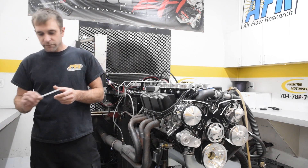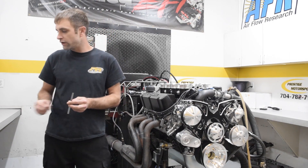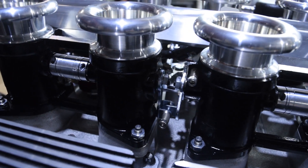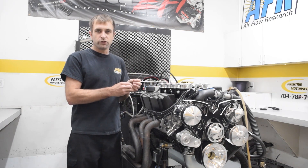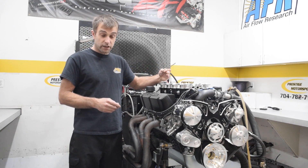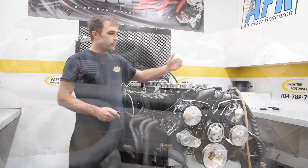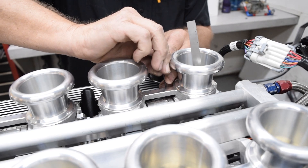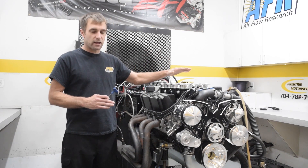We start with a simple feeler gauge — we've cut and trimmed quite a few of these and they serve two purposes. First, there's a screw on each side that controls all four throttle bodies. We take a 3-thousandths feeler gauge, put it between the throttle lever and the screw to get a base 'closed' setting, getting both sides close. Then with a simple allen key, we turn one complete turn on both sides. For a bigger engine like a 582 big-block Chevy, you may go one-and-a-quarter or one-and-a-half turns to get your baseline.